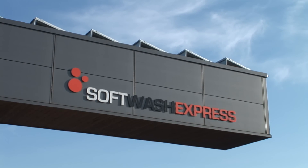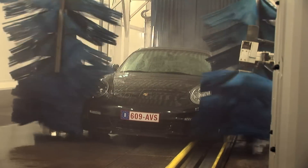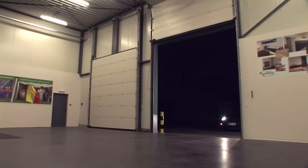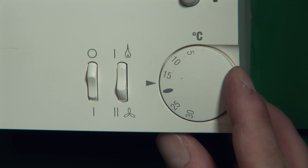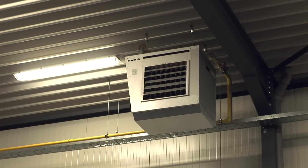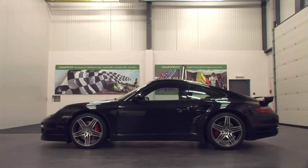It's very important that the car is washed thoroughly before starting the wrapping process to make sure all dirt has been removed. This is preferably done in a car wash without wax. The application of the film should be performed inside, in a heated area, at a temperature between 16 and 25 degrees Celsius. Also avoid direct sunlight on the car. The car should be placed in this space a day in advance to allow it to completely acclimatize.